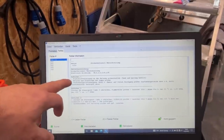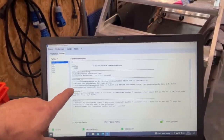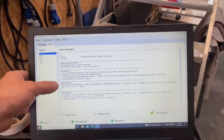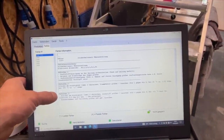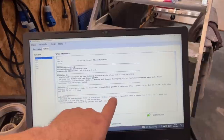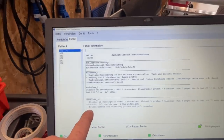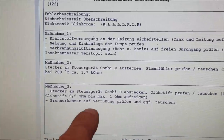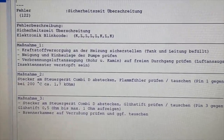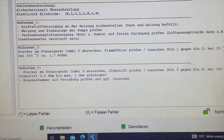Now we can check what's going on. Measure 1 - error description: safety time exceeded. We need to check the power supply, the pump inclination, the combustion air intake. And here comes the key issue: check the flue pipe for clear passage. That means it's not getting air. Check plug on control unit. And for the Kombi D device: glow pin - there we have it. Measure 3: check and replace glow pin. And here it is: check combustion chamber for sooting and replace if necessary. That, in my opinion, is the issue - and that will be the main problem why the heater won't work anymore.